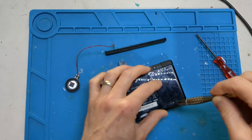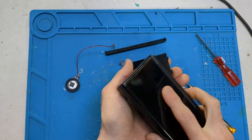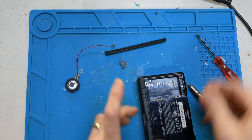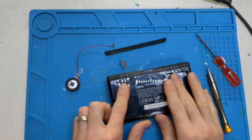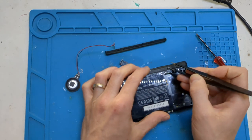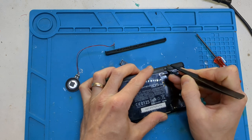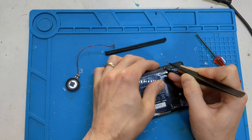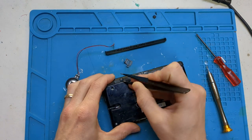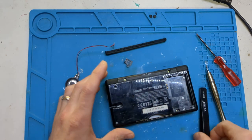Let's start with removing the battery. Use a Phillips screwdriver in there, flip it over, remove the cover and your battery has come out. There are two hidden screws here — there's one under here. You might just want to carefully remove these; they're only just stuck on with double-sided tape because you want to use these later. There's one there, and then there's another one here. So we have access to all the screws now.